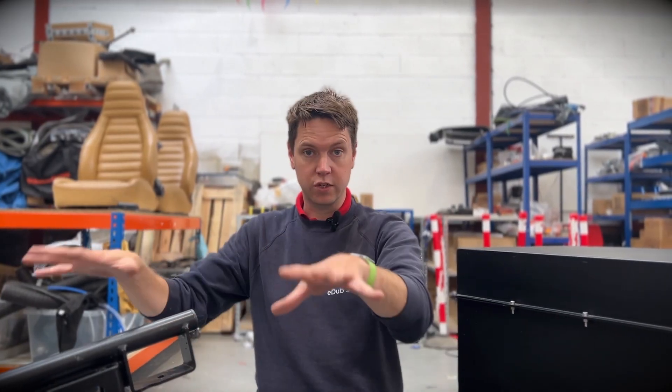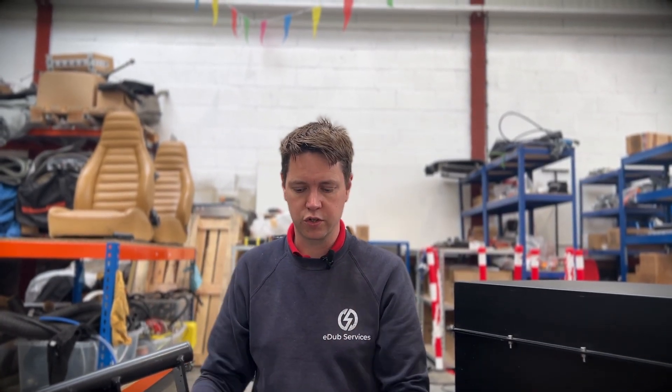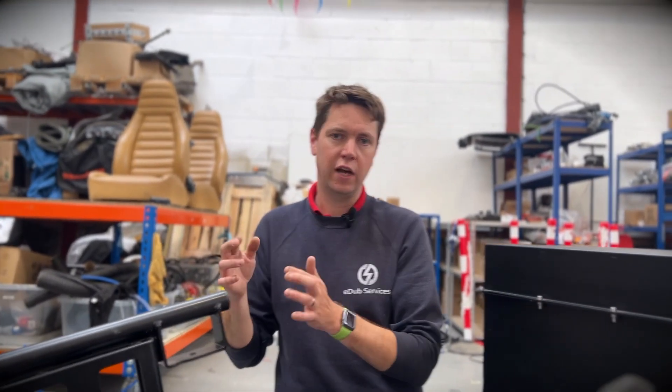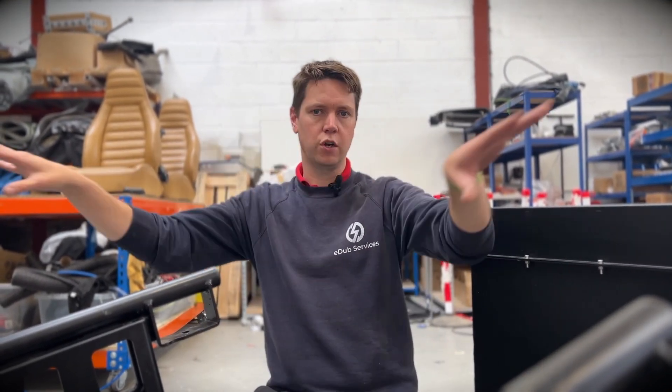We've built this on a clever pack and rail system. We have a base plate that fits into the petrol tank shelf and fixes on where the petrol tank shelf used to be, and then all the different components fit on top of that plate. Whether it's this particular inverter or a different motor, maybe the chargers — this is a fourth-generation charger, so when a fifth generation comes out we just change the mounting points, nothing else. You can also get liquid-cooled chargers for clients in hotter climates. This means everything can be assembled really nicely with all the wiring looms planned in, installed, and then forgotten about until it gets a complete revamp.